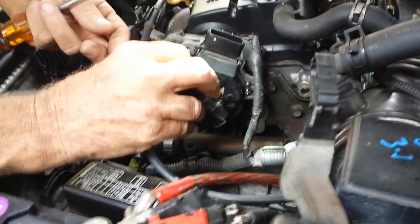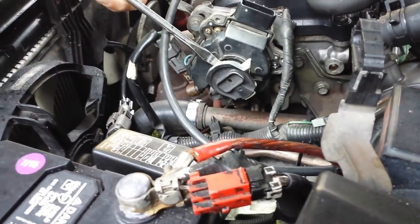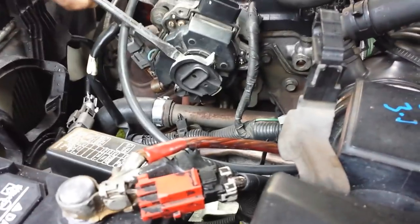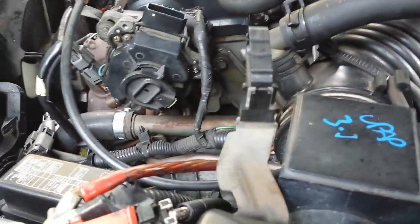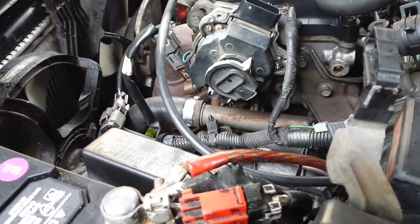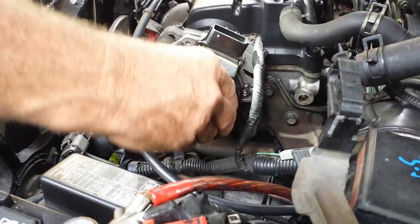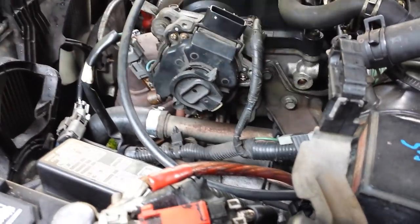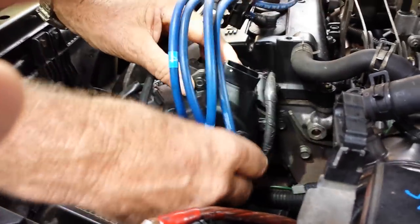As you can imagine, that rotor is actually a conducting piece. So if the screw falls out, it's no longer spinning and your engine won't run right. We put in a bigger screw — well, they had messed up the threads, so we had to tap out the hole a little bit for it to fit. Now it's on there fairly firm. So now, once we reinstall the cap of the distributor, we should be able to fire it right up.